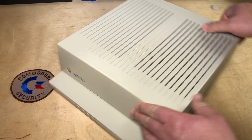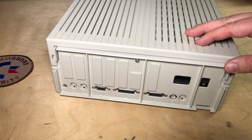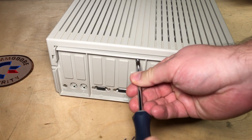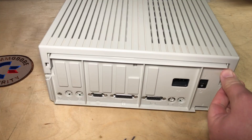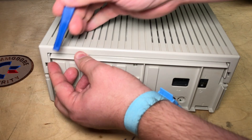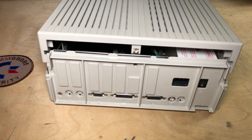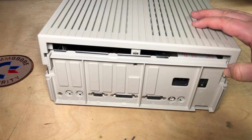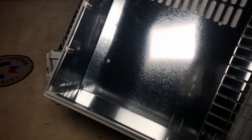Anyway, to open this up — I was trying to figure out how to open this up. The one video I found neglected to point out that there may be a screw here. So this one screw does have to be removed, and then these tabs can be pushed. I actually find mine really stiff. I found I had to just kind of pop something else in there. So it just has these tabs that you're supposed to push in, but mine don't push in quite far enough for it to come clear. And then the lid lifts off.